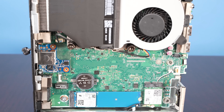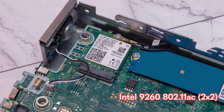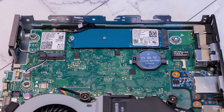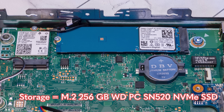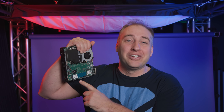Once you get inside you basically get an M.2 SSD slot as well as a Wi-Fi slot. We actually have Intel Wi-Fi in this generation — basically 802.11 AC, so you don't get Wi-Fi 6. This is definitely an older AC generation solution, and Wi-Fi is always optional in these. In terms of SSDs, this is a Western Digital SN520 M.2 SSD — a small solution on a much larger PCB. It's 256 gigs, PCIe Gen 3, and it's okay but not high performance. If you just need to boot into an OS it's perfectly fine, but this is one you'd probably want to swap out.